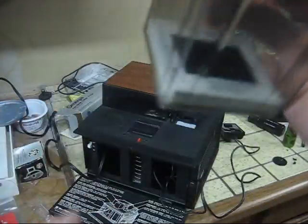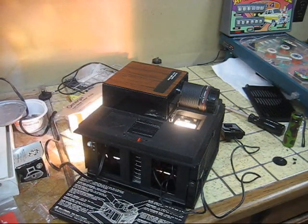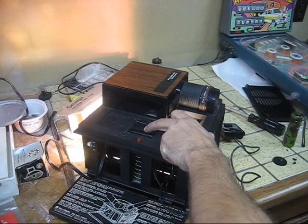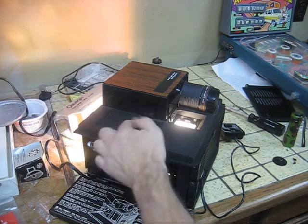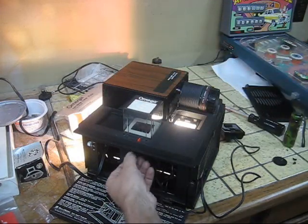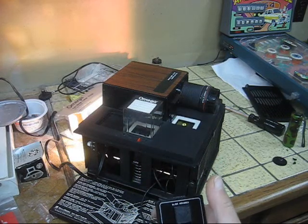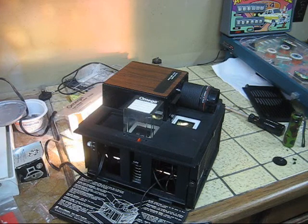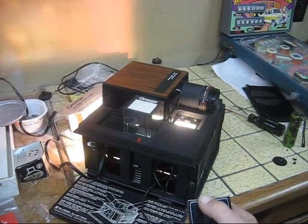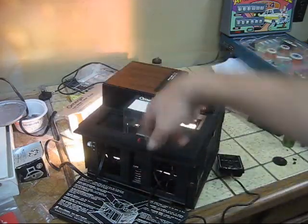Be careful with these doors - I think these broken ears here were the culprit of what destroyed the previous gear on this. Load it up with some test slides - pictures of the universe and galaxies. Be careful when you load: once you've ejected the magazine, this door right here likes to stick up. When you insert your new cube and go forward, make sure that's down or it's going to stick and catch. Here's the function test - in forward mode. There's the preview, and you can see as it comes around it's depositing the slides into the magazine.